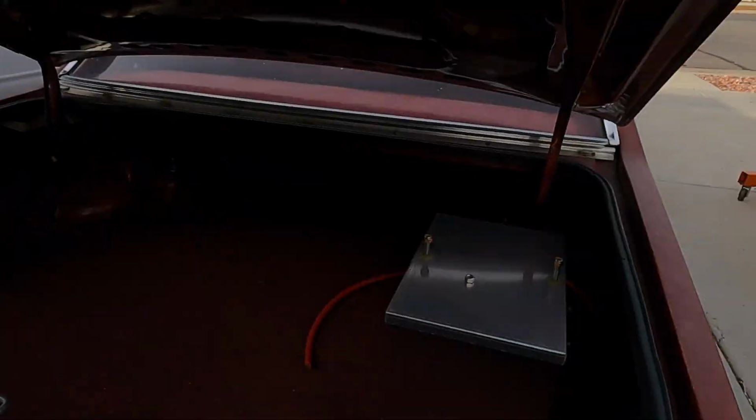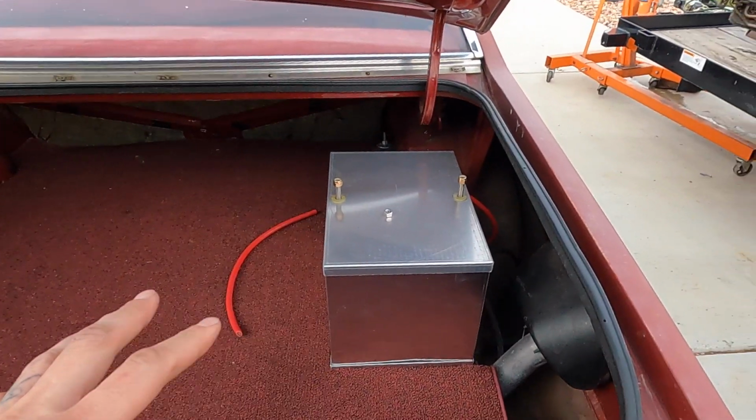We talked about the front suspension, basically all Fox body Mustang Cobra stuff. So Cobra brakes, 93 spindle knuckle, converted to a 5-lug because of that knuckle, the brakes, the rotors. Rear axle is an 8.8 from an 03 SN197, I think they're called, their chassis. So the other thing I did here, I put in a battery box for the battery relocation to the back. That's pretty much it.